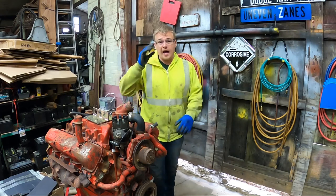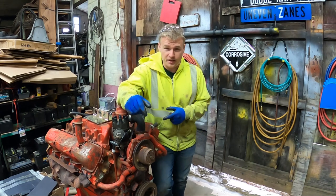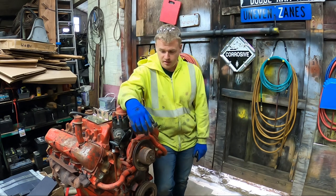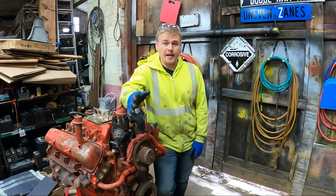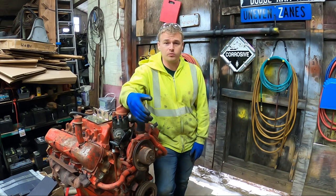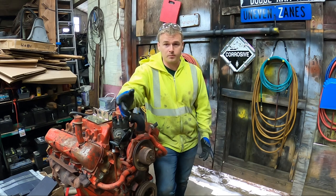Mocking up that exhaust outside underneath my Travelette would have been a pain if it wasn't for the simple fact that I got lucky and I already have an identical 345 sitting on an engine stand here in my garage. Due to the fact that the donut gasket thickness dictates how long the bolts need to be. The bolts for the flange come up from the bottom, and if they're too short, they won't go through the exhaust manifold and hold the exhaust to the manifold. If they're too long, they'll actually strike the bottom of the cylinder head and I won't be able to use them.